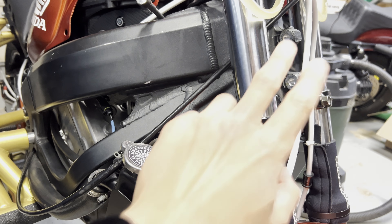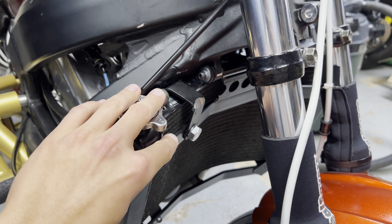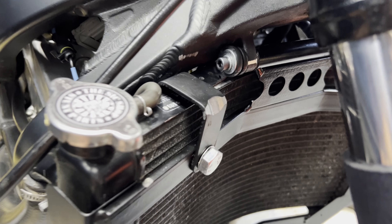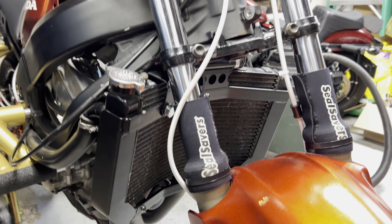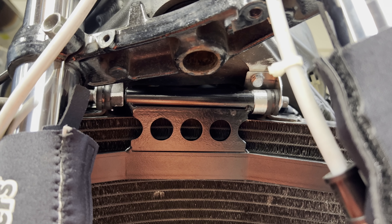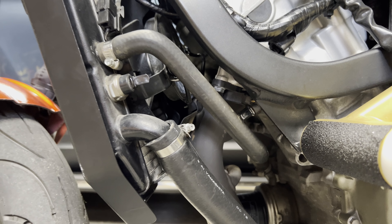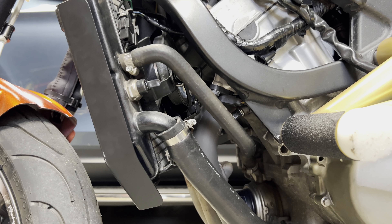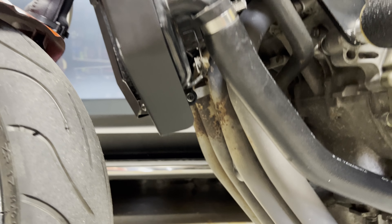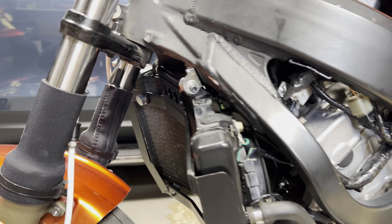I also had to grind down part of the bracket because with it now on the outside, it was too far forward. You have your fork stop on the frame and it was just missing that stop by about a paper's thickness, but it was still hitting the radiator. If I'm locking the bars to the right for tricks and drop the bike, I didn't want it banging the radiator every time. So I took the dremel and ground a bit away on that bracket so now when the fork comes in there's actual clearance. It's bolted in on both sides now, not hanging on the radiator, so hopefully that keeps the tabs and radiator as straight as possible.